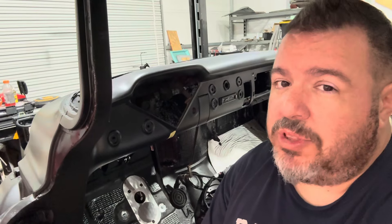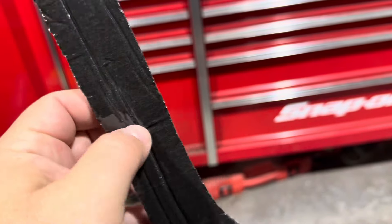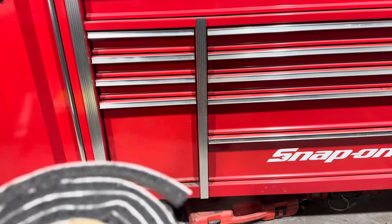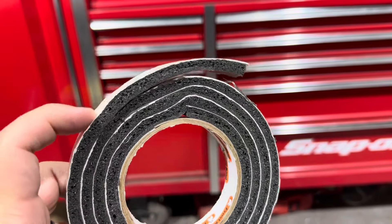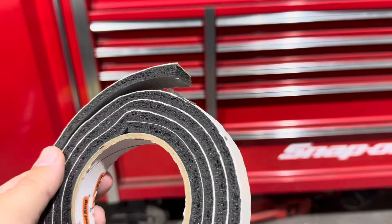I really wanted to make this custom floor plate because the original that came with the truck was just shot — I couldn't even make a template out of it because the screw holes were mangled. The diamond plate adds a cool extra detail. That hole I made slightly oversized at two and an eighth when the column is two inches, because you're going to have to adjust this in and out a bunch of times and I didn't want to scratch the new column. There's going to be a floor plate on top of the carpet that'll seal any space around that hole. I ended up not using the cab insulation foam as a gasket because it has a plastic layer on the back that could melt near the headers. Instead I used regular foam weather stripping — peel the adhesive layer off and you've got straight foam on both sides, a little bit thicker, compressed real nice, and now I know for sure I've got a really good seal.